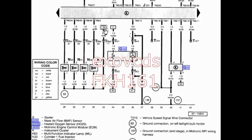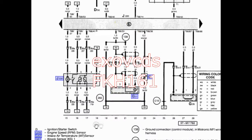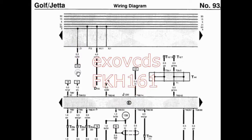They follow the power wire to the box that says 16, which means this wire continues on circuit track 16. These are the track numbers at the bottom of the wiring diagram. So track 16 is on 33 — you go to track 16 and look for a 33. Here we are at number 16; scroll up until we find a 33, and here it is — this is the power side for those injectors.